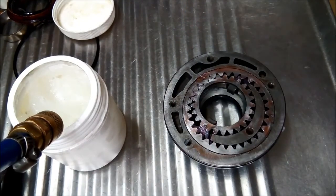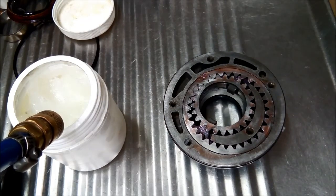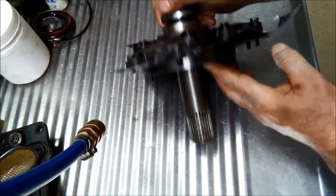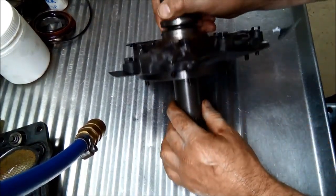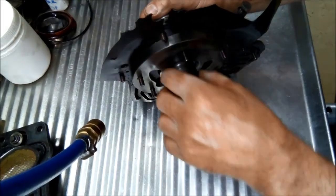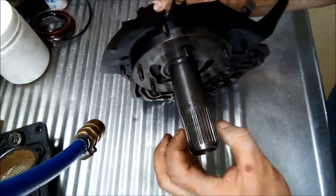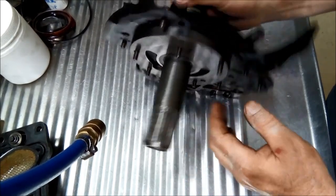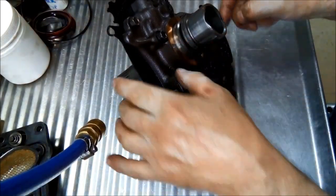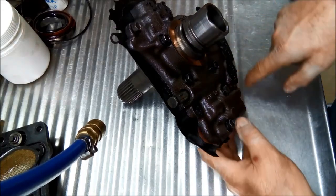The front pump is ready to be bolted to the valve body. Here's the valve body - the pump bolts onto that. You can see the end cover there, and the splines for the stator shaft that sits on the stator in the torque converter. We're now going to pull this apart and clean up all the valves, replace the sealing rings and gaskets, and go through the valves to make sure they're all nice and clean.